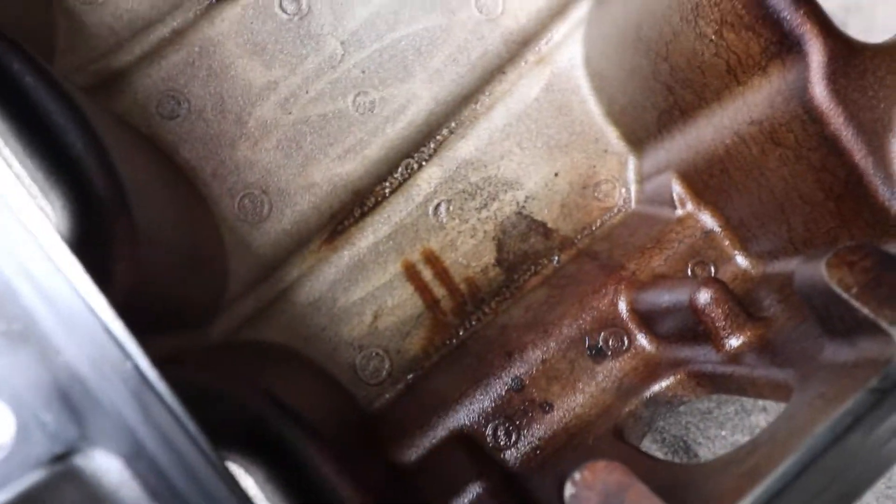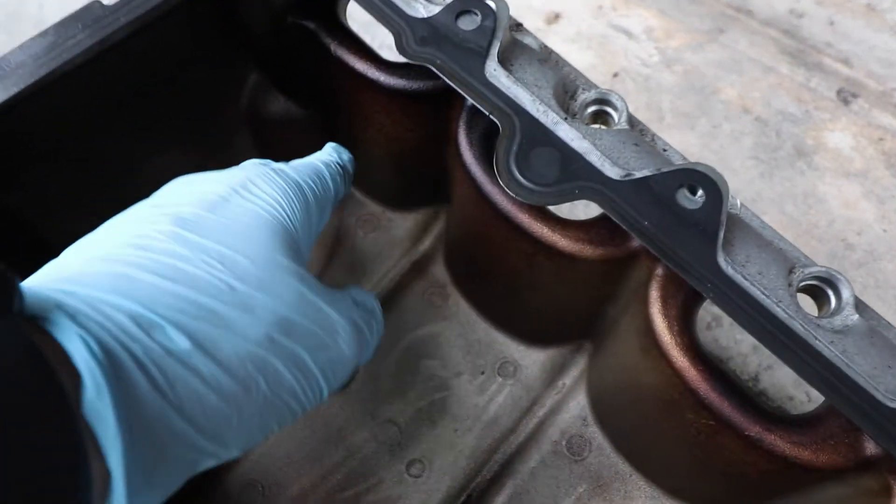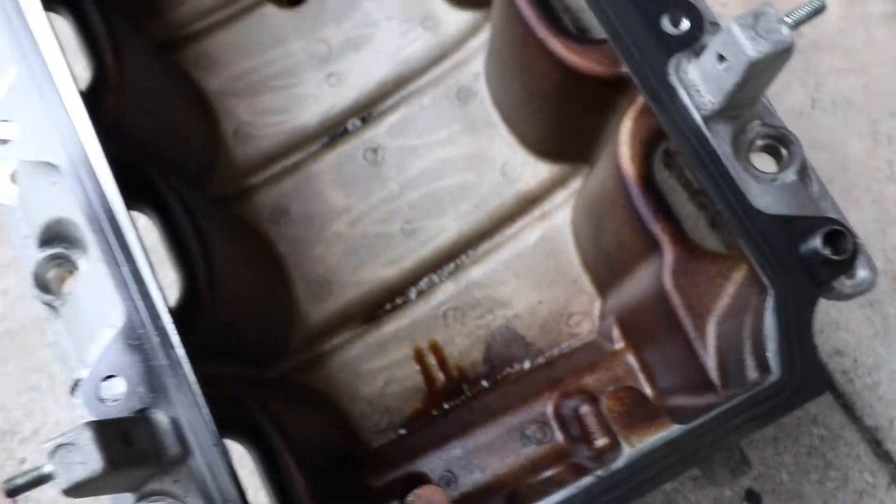You can see oil right there on the bottom — these are the ports for the head and they're filled with oil from years and years of not running a catch can. This will definitely help you out with your supercharged or boosted motor, or if you have a turbo, because those crankcase pressures on the valve covers are tremendous and will route oil into your supercharger or intake manifold. These things will literally save your motor. Hopefully you learned something new and found this video helpful — thank you for watching, take care.